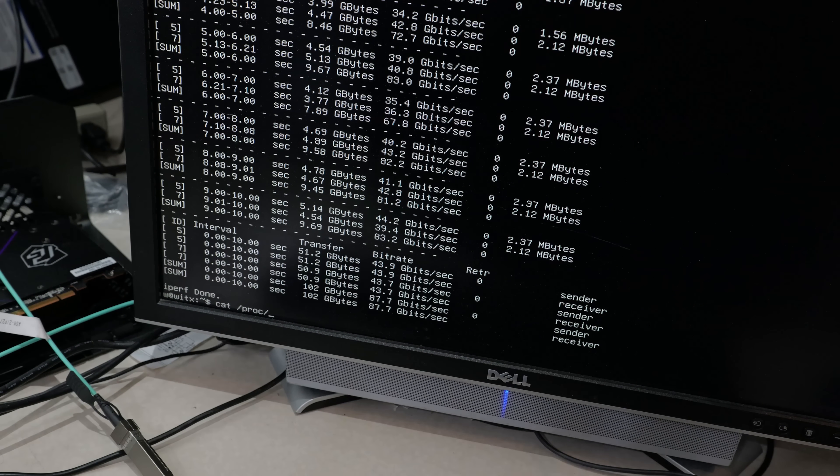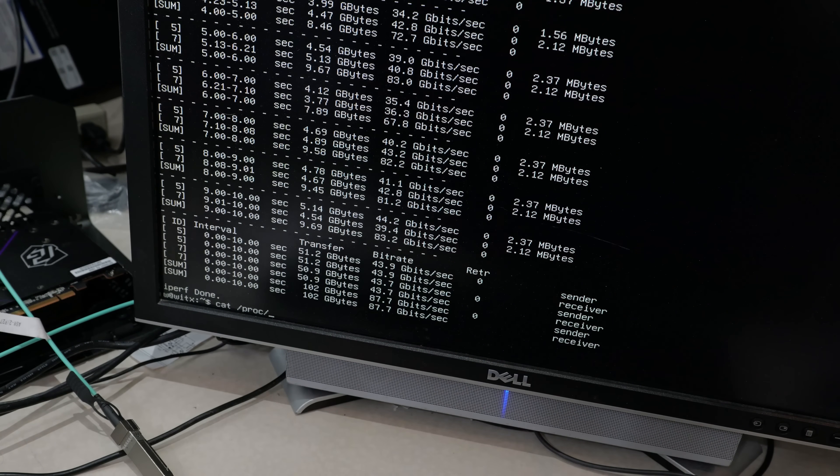You can do that with 10 gigabit, 25 gigabit, or as I've done here, a 100 gigabit network. With a 25 gigabit NIC, your maximum throughput is about 2.5 gigabytes per second with very low latency — so it feels better, honestly, than a SATA hard drive, as long as the rest of the storage backend is fast enough to keep up. ZFS doesn't have as low latency numbers as you'd have from a local SATA hard drive, but for game storage like Steam, it'll run just fine over iSCSI. We have some guides for that on the Level 1 forum.